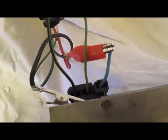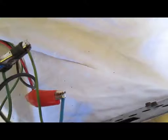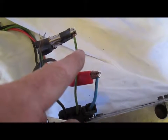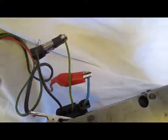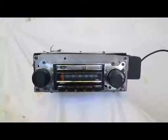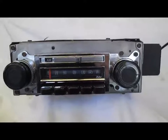Really easy hookup. The plug is not included, but I need to use it to test the radio — if you need a plug, let me know. My 12-volt power hooks up here, your speaker hooks up to the green cord, and the black and green is for the ground on the speaker. The radio is grounded out here. Three simple wires and an antenna. We have it hooked up to a 12-volt power source and the correct 8-ohm speaker.